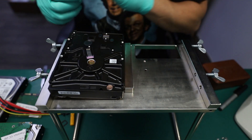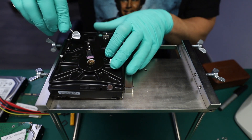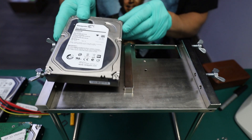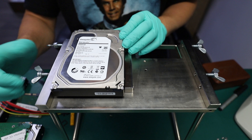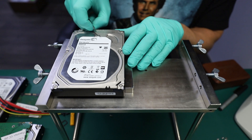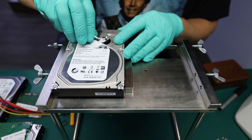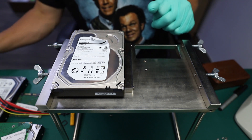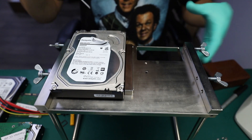I'm going to go ahead and undo the PCB now so we have access to the screw that keeps the head assembly in place. The donor is currently undergoing the backup process, so I want to make sure I have all the resources for it, just in case the parts aren't accepted easily and I need to do modifications using the adaptive data from the patient. It's important to be ready for that while the donor is still functional. Then I'll start disassembling the patient, going through ATA commands rather than terminal since terminal may take a while.